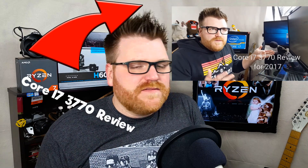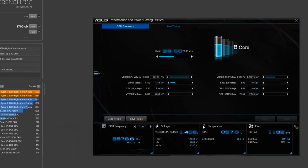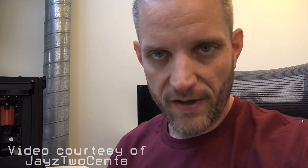Just to put this into perspective: my i7-3770 — four cores, eight threads — Cinebenched around 660, as shown on screen. With the Ryzen 1700 I'm not quite tripling that, but I'm in the neighborhood of it. I overclocked this chip and got a Cinebench score of 1700 last night, fitting right in line with the 1700 moniker. That's 1800X-level performance — you can maybe get 50 points more out of an 1800X on Cinebench if you overclock.